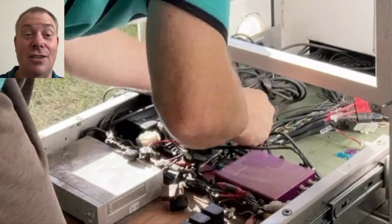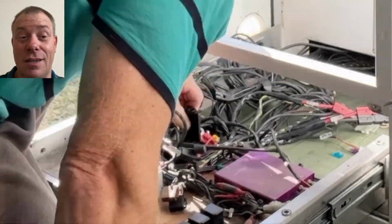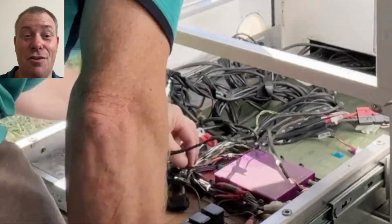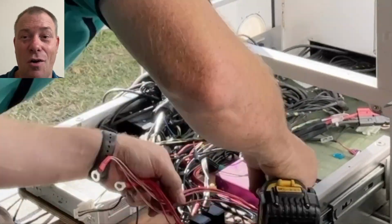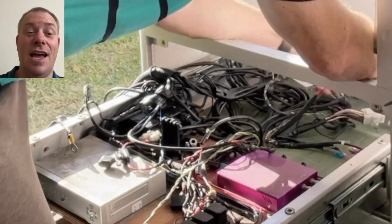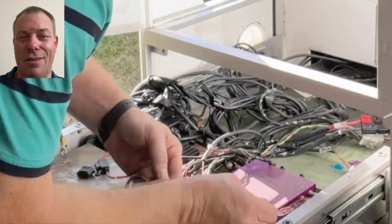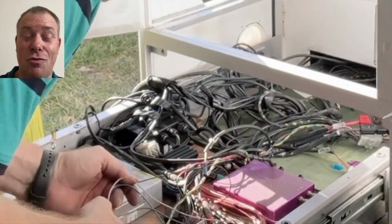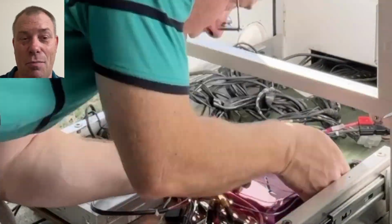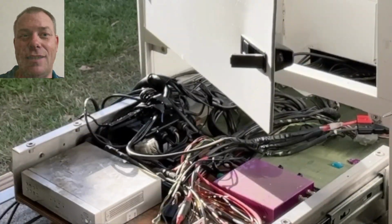Well, luckily later on I find out what I did wrong with the aid of a separate TV, and everything's good. I've got it all working. All I've got to do now is chase all the cables through, disconnect them from the various points, and then I can remove the cables. I don't want to cut them, because if I cut them and then it shorts live and neutral somewhere, then I end up having other problems. So it's a long-winded process, but we're getting there.